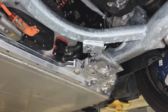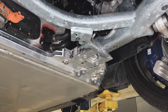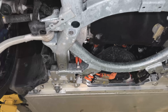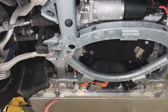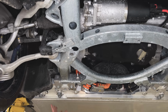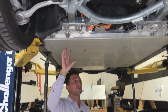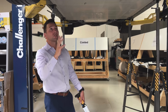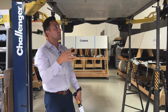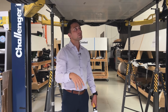And that's probably driven by, obviously, needing to hold the pack, which is substantial in terms of weight, but two, now all of the rear suspension loads, both dynamically in a driving scenario or in an impact condition, this is managing the entirety of the rear end of the cradle's load going into the vehicle. So it's all hard mounted and it is contributing structure to the body, but it is interesting that they decided to mount exclusively to the body.